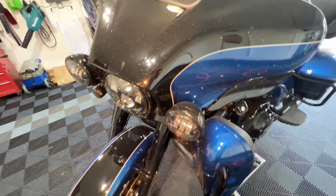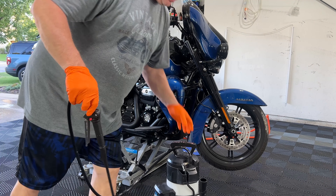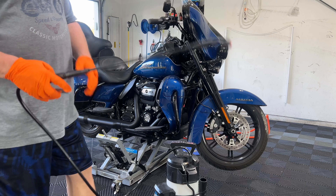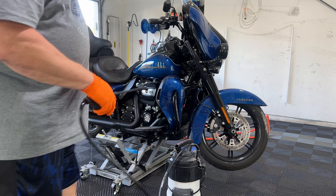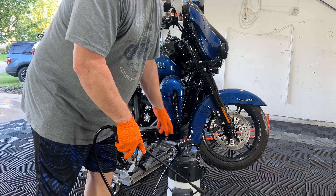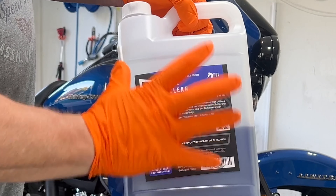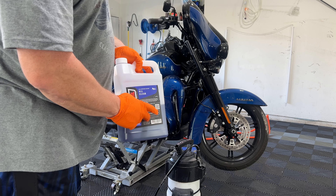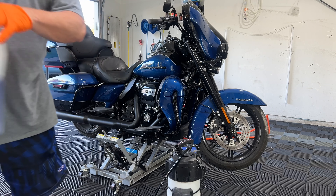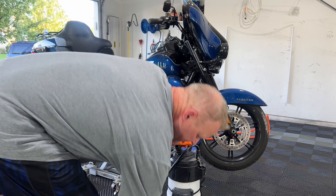I'll kind of take you through the chemicals and a little bit of my process when I'm detailing a motorcycle. This is an IK eFoam Pro 12 — it's got a battery pump on it. The first thing I'm going to do is use DIY Details All Clean. When you buy it by the gallon, you need to dilute it 15 to 1. With about two gallons of water, you have about 17 ounces of All Clean, and then a splash of their Incredible Suds Soap.